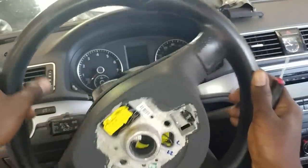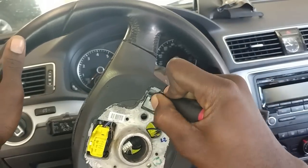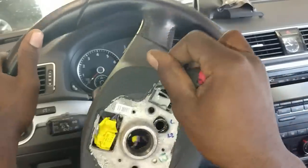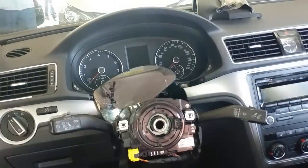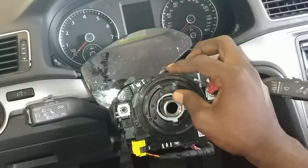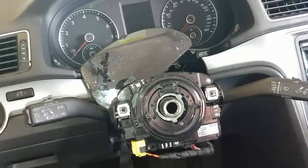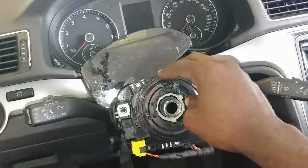To get this side up here and then you want to put this in there again. That's it — that's how you take this part off. Now it's time to remove the locks. Make sure you keep this in one place — don't let it go all over the place, because there are ribbons in here. You don't want to break it, or the airbag light's gonna come on, your horn's not gonna work, your controls under the steering won't work. So you want to keep this at this location — don't move.